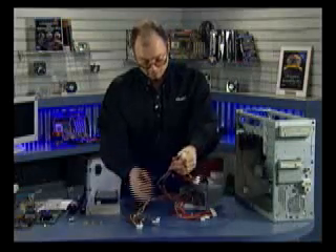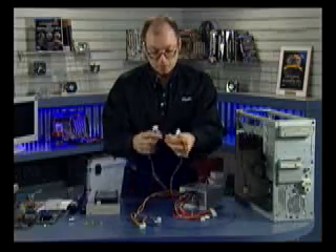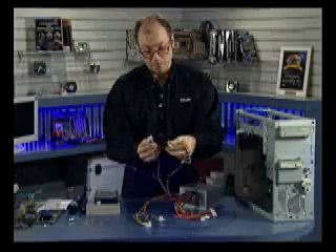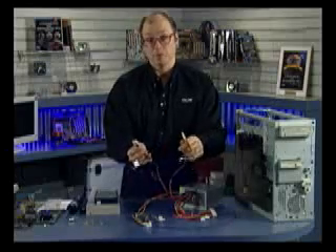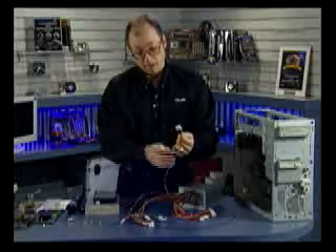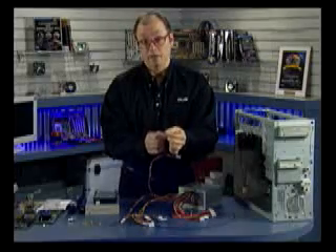It's best to balance the load. Although there are two connectors on one cable, since I'm only attaching two drives, it would probably be best to use two different cables to equalize the load. So I'll pick one cable for the CD-ROM drive, one for the hard drive, and one of the smaller connectors for the floppy.